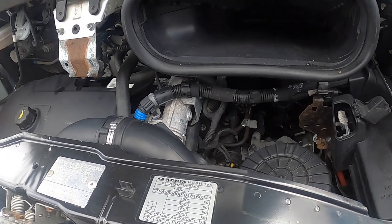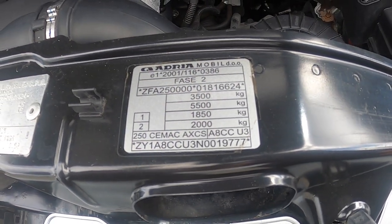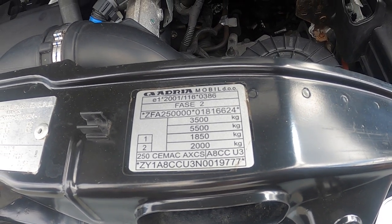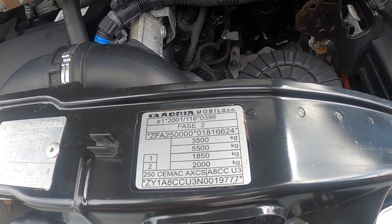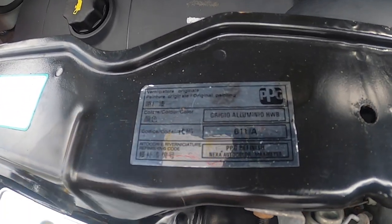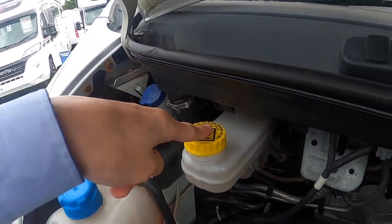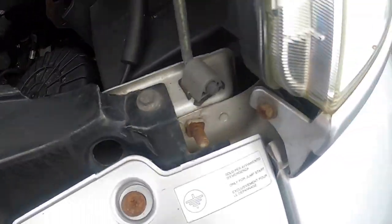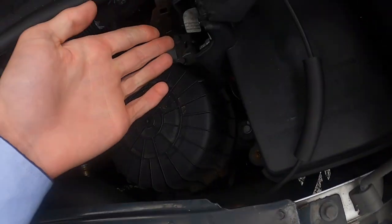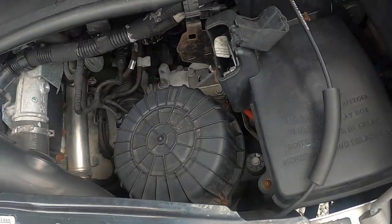Underneath your bonnet you've got your weight plate — it's a 3.5-ton vehicle, so always go off the Adria plate because this is a phase 2 conversion. If you were to put a tow bar on, the combined train weight must not exceed 5.5 tonnes — that's the motorhome weight plus whatever you're towing. You've also got your front and back axle weights and chassis number. You've got your paint code for the silver cab, your radiator fluid, power steering fluid, screen wash, brake fluid, oil filler and oil dipstick. For a jump start, your earth point is where the black clip goes, and your positive is under here where the red clip goes.